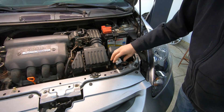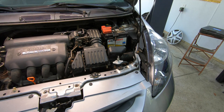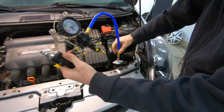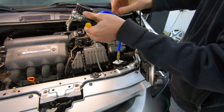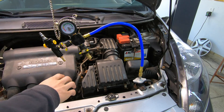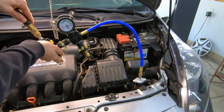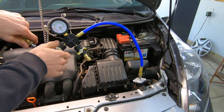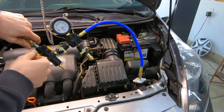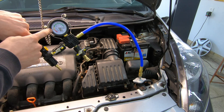To use this, you take the adapter that fits your particular car, put it onto the radiator cap, then grab the vacuum generator that's going to pull a vacuum on the system and attach that to the adapter. Once the vacuum generator is hooked up, take compressed air and hook it to the top of the generator. Then you open this valve, leave this one closed, and you'll see the gauge pull vacuum on the system.